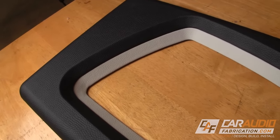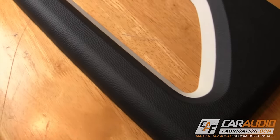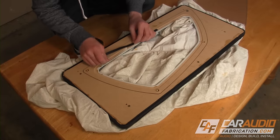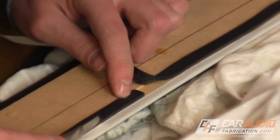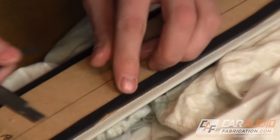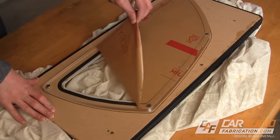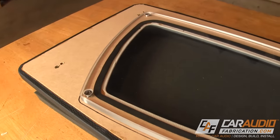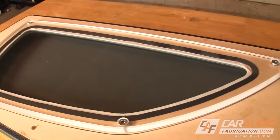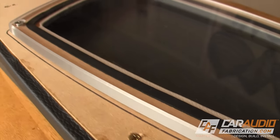In the meantime, I've wrapped my panel with vinyl. If you were building a subwoofer box, you would now add the window wall to the box in complete assembly and then upholster the subwoofer box. To prepare the box for adding the window, you would first add gasket tape around the step that we cut earlier. When it gets to the part where it meets up, cut the tape at a long angle — this helps prevent an air leak at that seam. After removing the protective paper from the window, I position it in place and then bolt it in. All that we have left to do is peel away the backing paper, which is such a satisfying feeling. Adding an acrylic viewing window like this can really make a subwoofer box much more appealing. When done right, it will look perfect and never leak.